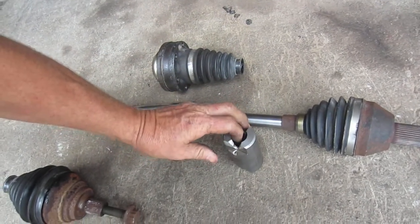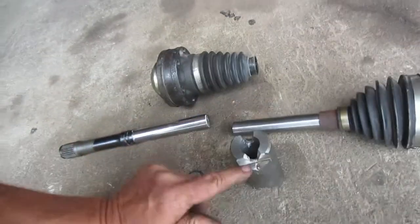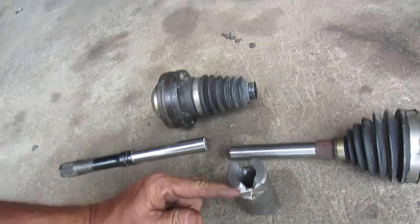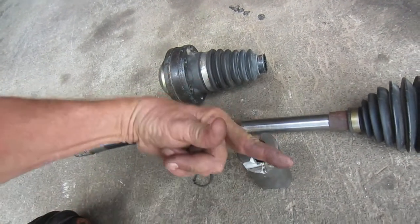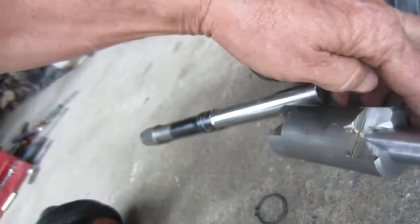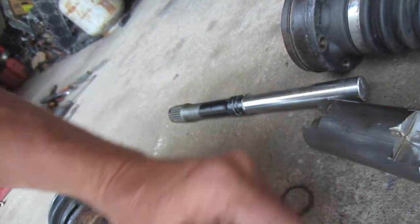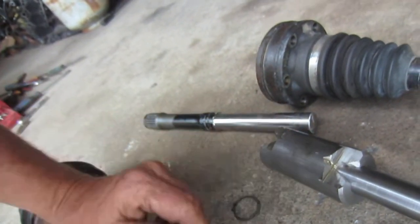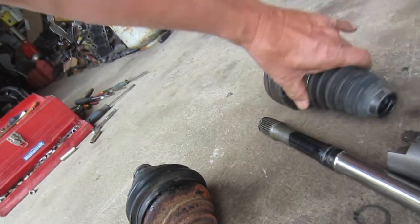There are V-grooves cut in there on both sides. I cut some off with the cutting wheel grinder, drill a 3/8" hole, cut an angle this way and an angle that way. When assembled, it's not just a radial weld — there's a weld in there too, so it makes it harder to fracture and harder to shear.